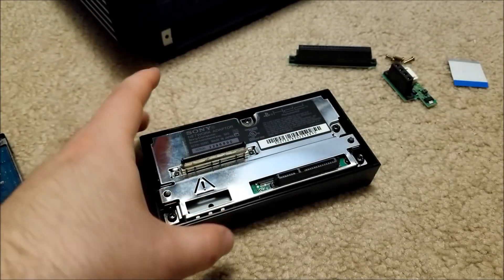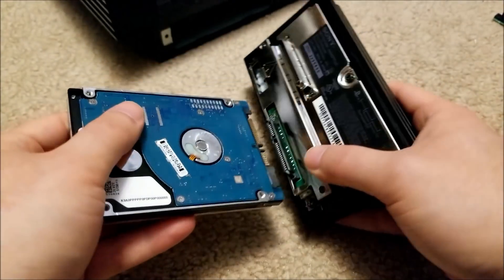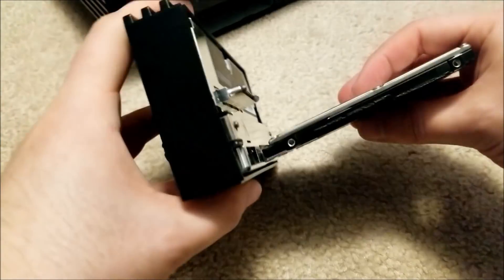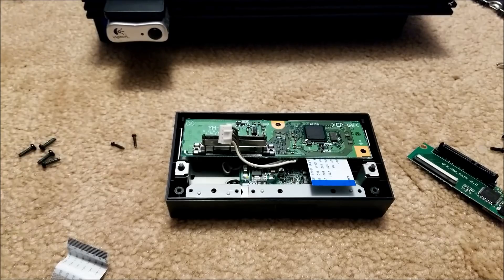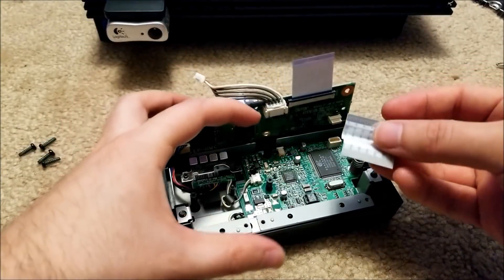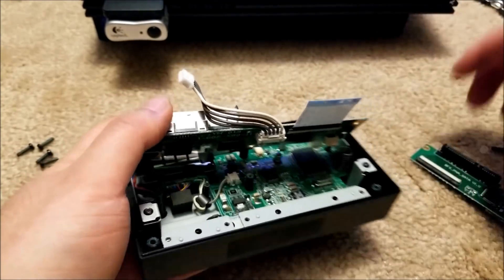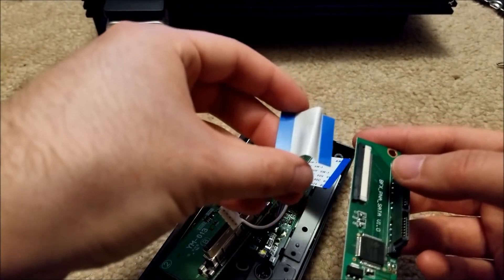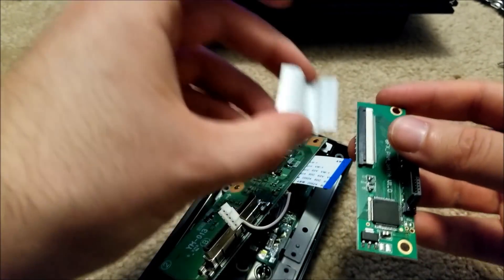So let's just give it a test fitting. We got our SATA drive here — upside down, okay, label side up. Yeah, fits. It's a little bit crooked. Okay, so I just tried it and it didn't recognize the drive at all. The drive didn't even spin up. One mistake that I made — kind of a rookie mistake, a little embarrassing — is I used the original connector. Here you can see both the blue tabs are on the top side. The one that they provided has one blue tab on one side and the other on the other side. So obviously you have to use the cable that they included, because it actually needs to flip the connectors. If you hook it up with the original, the pins are facing up, but on the SATA board all the pins are on the bottom — so it was as if it weren't even connected.